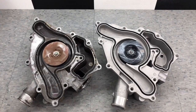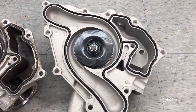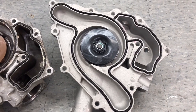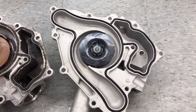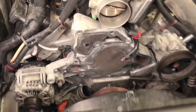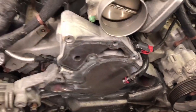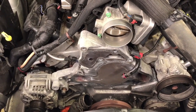There's a side-by-side of the two water pumps. It's just a rubber gasket that sits down in a little groove. What I do is put a real thin coat of grease all the way around both sides of that gasket before I set it down into the water pump — it just helps it seal a lot better. I got everything cleaned up, got my surface all cleaned. I put a little bit of grease around the o-ring here too, just so it helps it slide in and seal up a little better. Next step is to get this water pump put back in there.